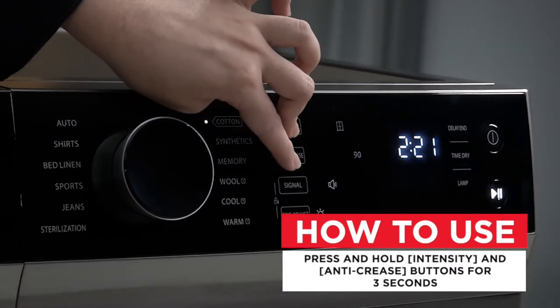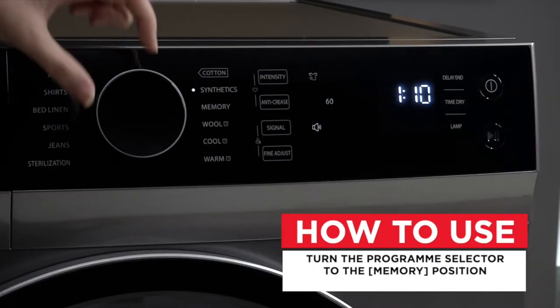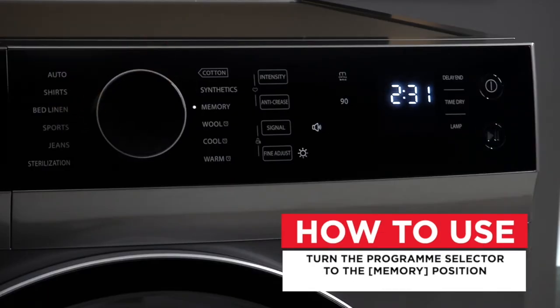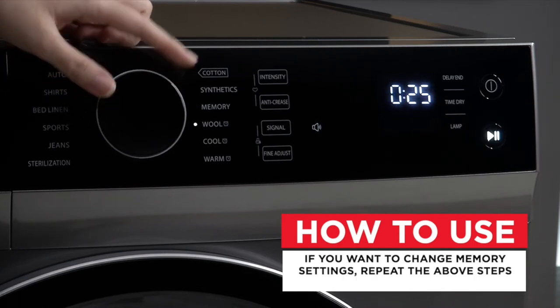Press and hold the intensity and anti-crease button for 3 seconds until the beep and the required program has been saved. Turn the program selector to the memory position. You can start your favorite program. If you want to change the memory settings, repeat the above 2 steps.